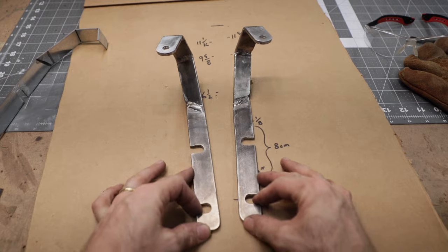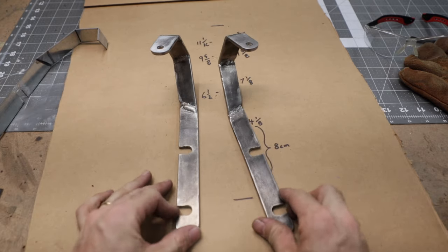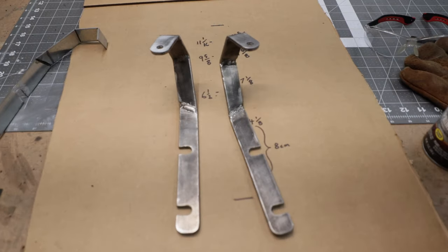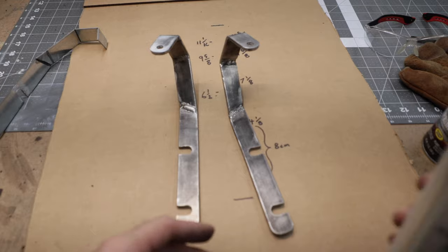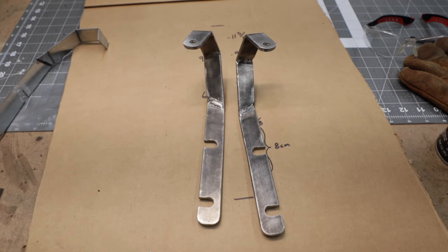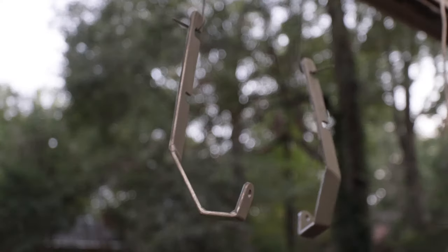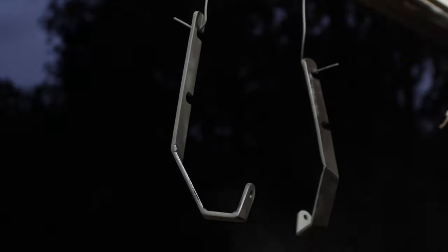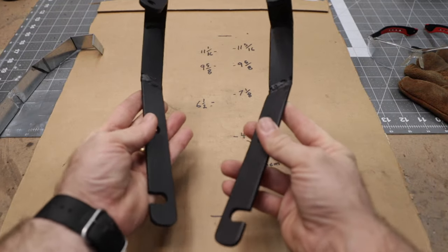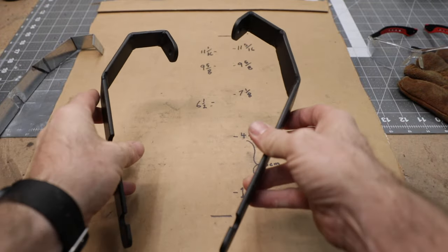This looks way better — you see what I mean? It just looks so much more finished. Here are the two brackets, basically exactly the same. I think they look really good. Now to finish them off, I'm going to hit them with a little self-etch primer — this is my favorite primer for bare steel. I'm still going to scuff the surface a little bit with some sandpaper, and then after primer I'm going to use some high performance enamel in flat black. Here's the final product — I think this looks really good. Let's get these guys installed on the vehicle and install the lights.